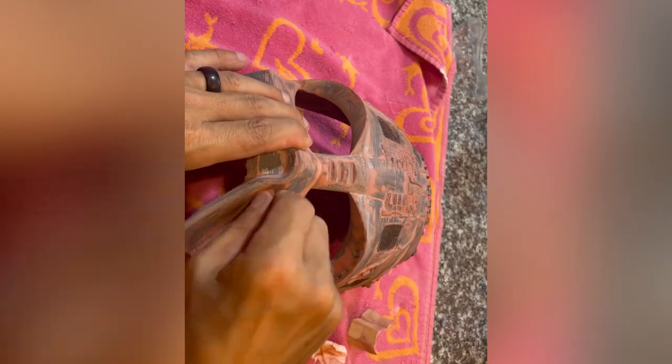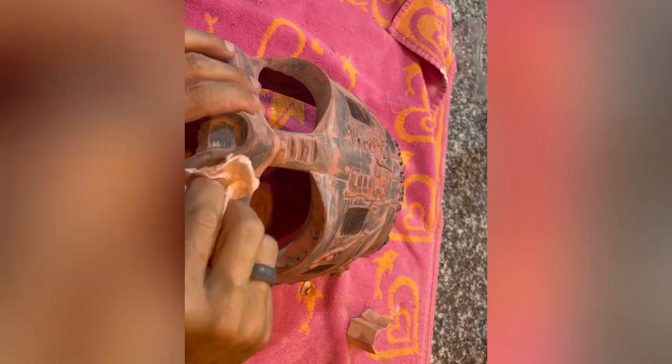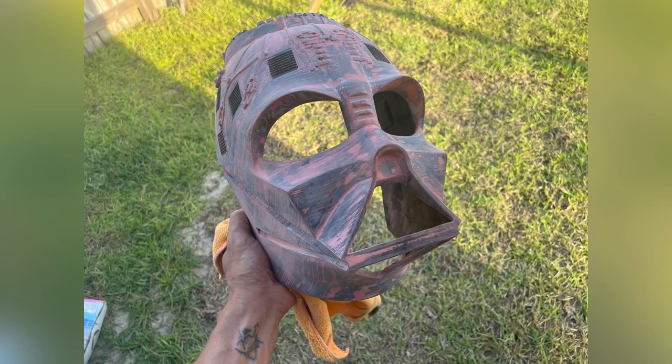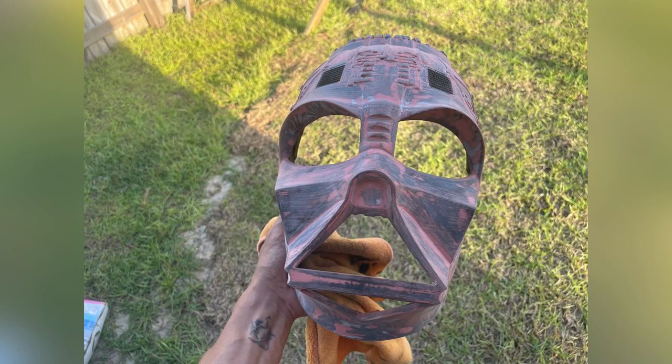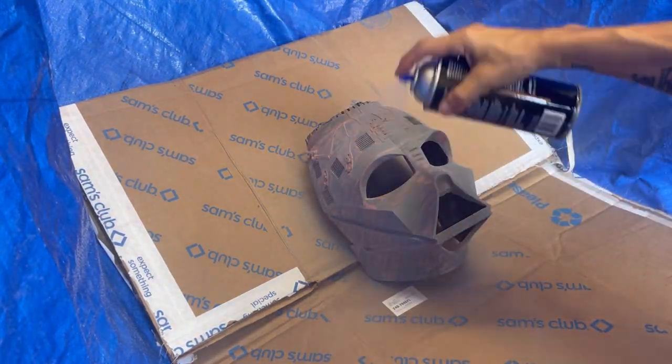So basically after I sanded the whole thing with 220 and 320, there's some final end shots right here. It was ready to have a couple applications of Bondo Filler Primer, which was about 2 to 3 coats, and it leveled everything off beautifully and made it look great, and was pretty much prepped for final sanding.